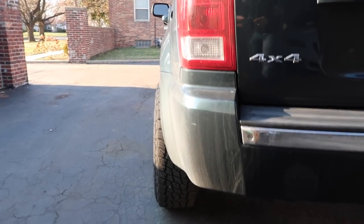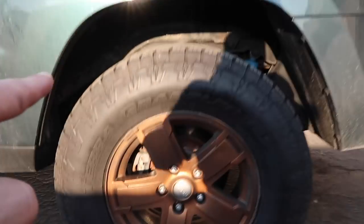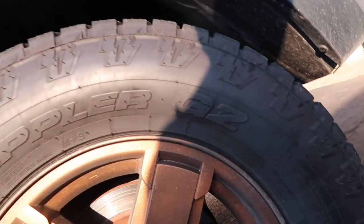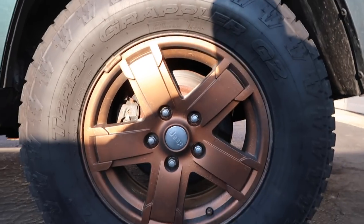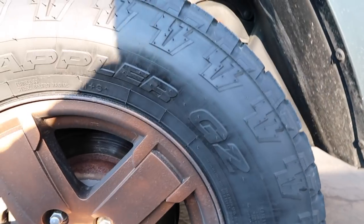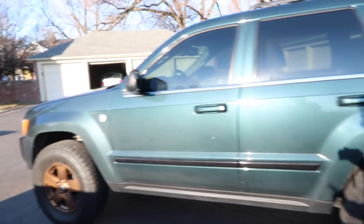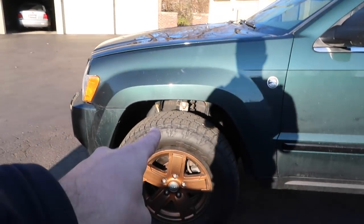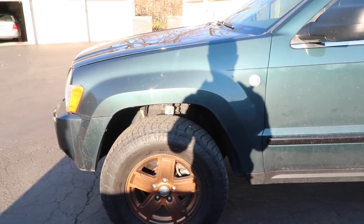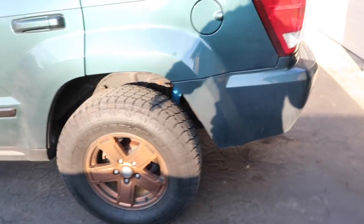It has a bit of a stance to it — not tremendously, but it has one-and-a-half-inch spacers on all four wheels just to make them look a bit more rugged. Now, the lift and tires: these are Nitto Terra Grappler G2 all-terrain tires, sized 265/70/17. They're a little louder on the highway but nothing too hard to deal with. They do rub slightly only when I go full-turn full-tilt on the steering wheel while reversing; going forward seems fine. Without the spacers, they'd rub on the front control arms.